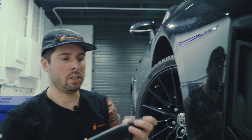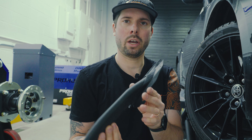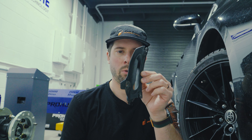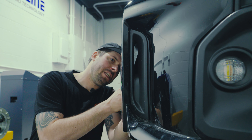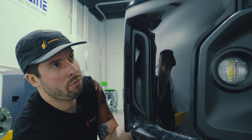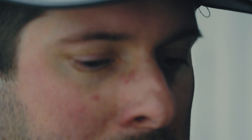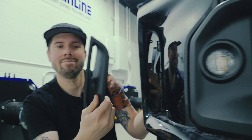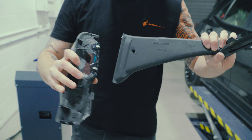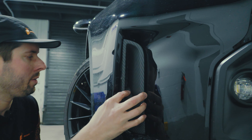Taking this piece out — it slips onto the vent as well as onto this little trim piece. This is the piece some people have to trim if they lower the car and put wheels on. Two screws: one at the top, one halfway down. Would this be easier with the bumper off? Sure. Is it necessary? No. If I had a traditional lift or was lying down it'd probably be even easier. These tabs I'm just going to push out. Wow — look at that, should fit. Even with the mesh over it we still get nice airflow.